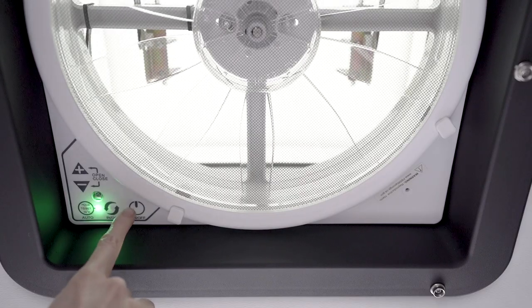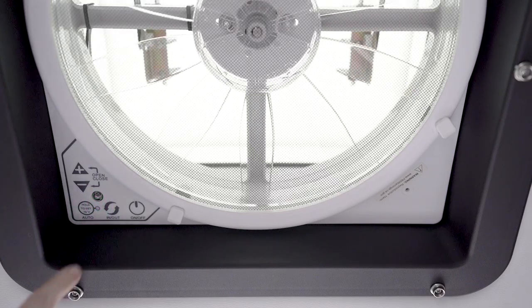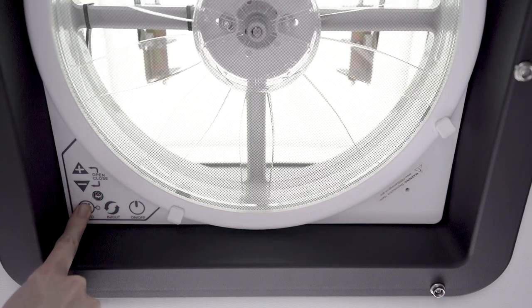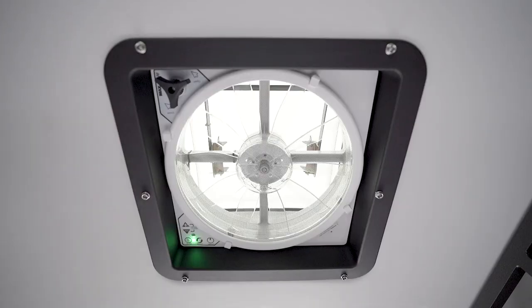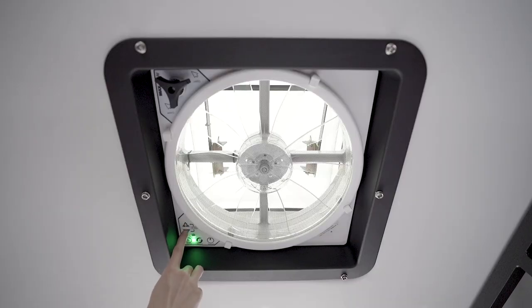To exit Auto Mode, press the on-off button. Initial factory settings for the thermostat is 78 degrees Fahrenheit. The green LED will light to indicate the Max Fan is in Auto Mode. To change the set temperature, press the hold-to-set button for more than 3 seconds and you will hear one long beep, and the thermostat will be reset to 78 degrees Fahrenheit. To further adjust the set temperature, use the plus or minus arrow buttons to adjust the thermostat up or down in 1-degree increments per press. The fan will emit a beeping sound to confirm this setting. If a previous thermostat temperature was entered, the fan will remember this temperature setting, and the next time you enter Auto Mode, the fan will start ventilating automatically.